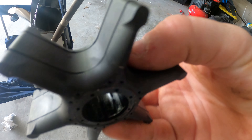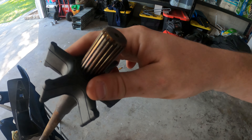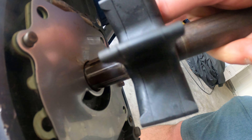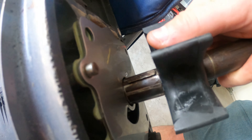There is an indent in here — you can see it right there. It's cut out on this side but not the other side, and that's the side at the bottom. Line up the indent; otherwise it will not sit flush. You know it's right because that's the only way it's going to sit perfectly flush.